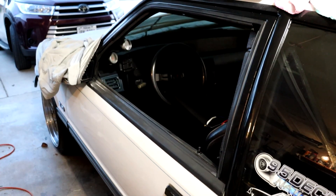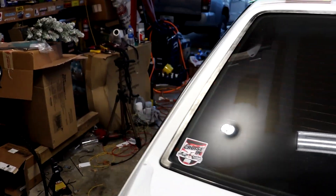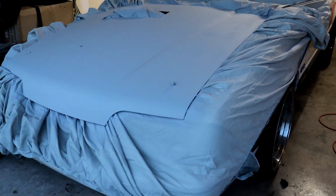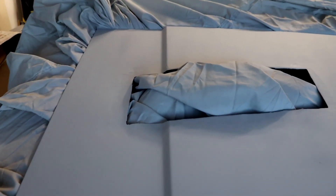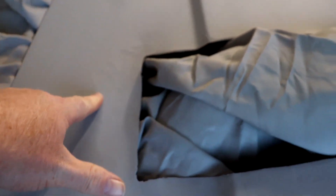The next thing I've done to the car — you can see the old hood is off, just sitting here. Got a hood from Brian at B&T Garage, hooked me up with a stock-style hood. Got a coat of primer on it right now. Had to do some trimming and I'm not real happy with it — when I cut it out using the grinder, it really dug into the hood. You can see it now on camera where it dug in, and I really didn't notice it until I put some primer on.